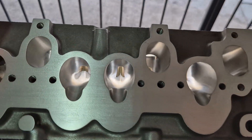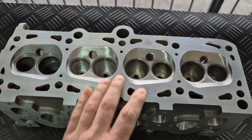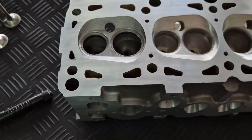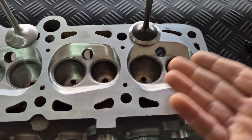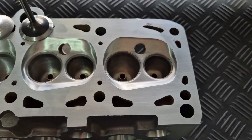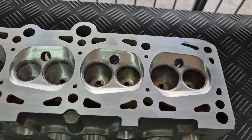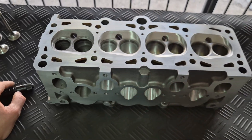We like the bullet shaped guides — it helps a little bit. We don't only offer fixed packages where you have to go this or that. You can go Stage 3 with a back cut on your valve, or Stage 2 with a float valve. You can tell me you want a three-angle seat instead of a radius seat, and we can do that — no problem. I'll make recommendations based on our development, because we haven't found anything that gains on top of this type of setup on 8 valve. Thanks for watching, guys.